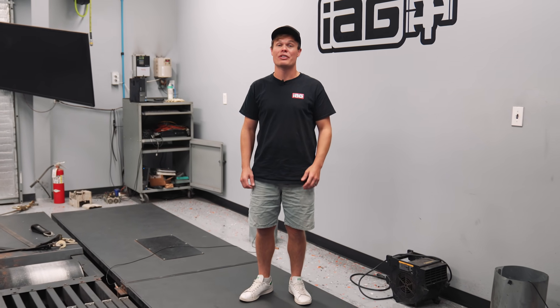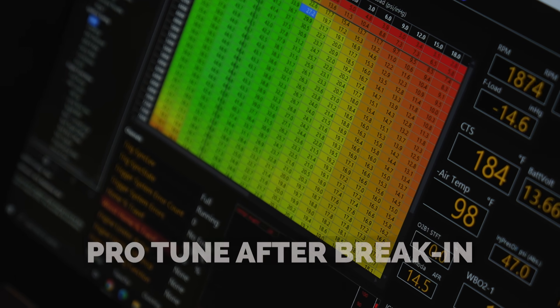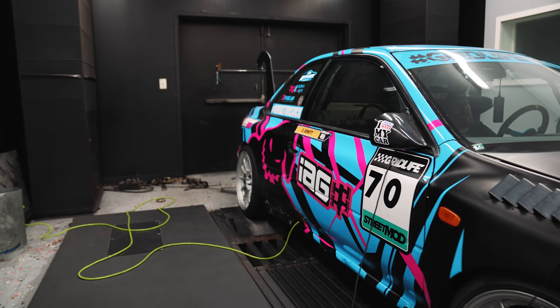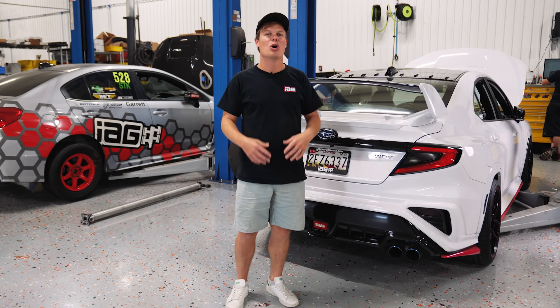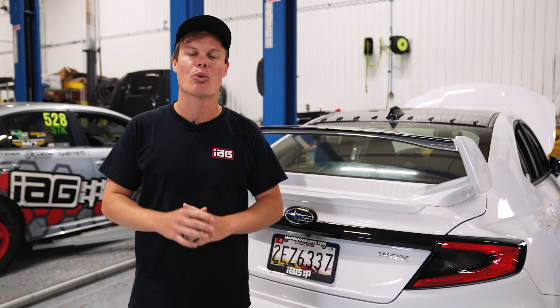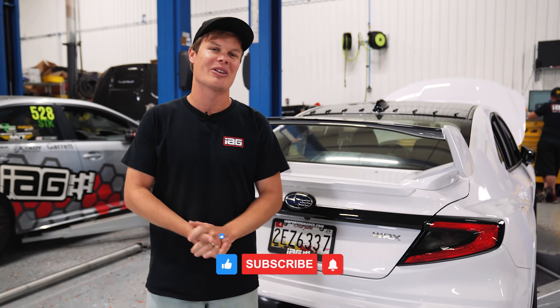After 750 miles, you can change your oil to a synthetic-based oil and get your car tuned on the dyno. If you have a dedicated race car — no registration, no license plates — there's a completely different dyno break-in procedure, so make sure you reference our website and check out our break-in manual. That's pretty much it for the engine break-in procedure. I hope you found this video helpful. We still suggest you reference all the information in the manual in case I missed anything. If you like this content, hit the like button, subscribe, and I'll see you guys in the next video.